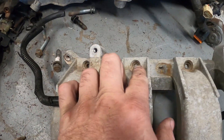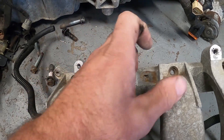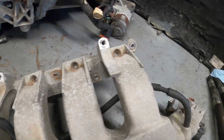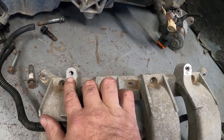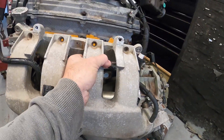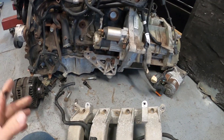Right here is where your O-rings go for your fuel injectors — they place down into here. This one still has them in; they need to be picked out because the fuel injectors that were in this one were no good. The fuel rail gets screwed down right here.